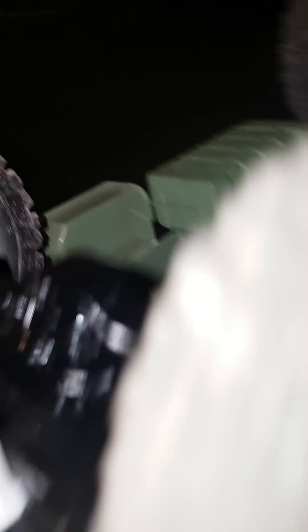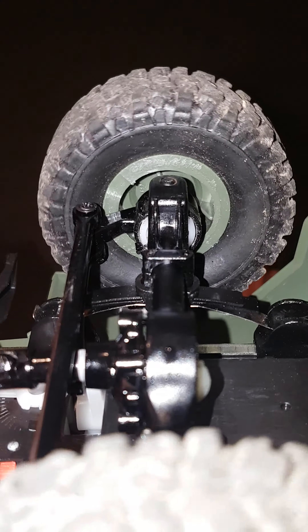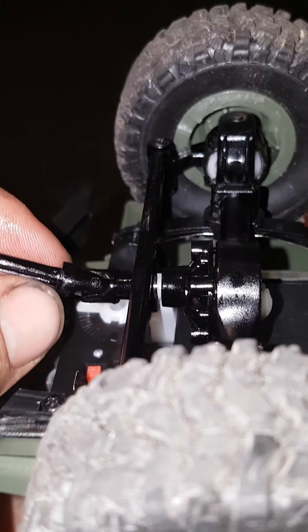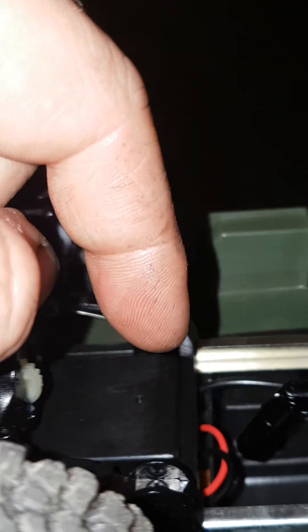There it is on the front. I'll tell you where I'm getting here — you could then have another one of these, like grab another diff with another tower shaft running off the back there. So if you wanted a six-wheel drive truck, you could just run the front — just get another front piece with the tower shaft — run it off the back to the rear diff to drive two diffs. So that goes to your transfer case, down through the diff, through the drive to the second diff.